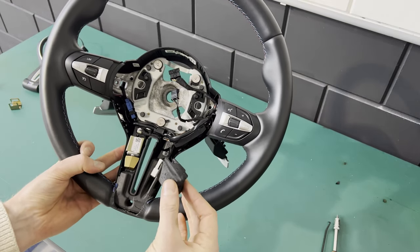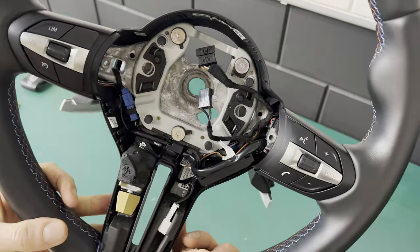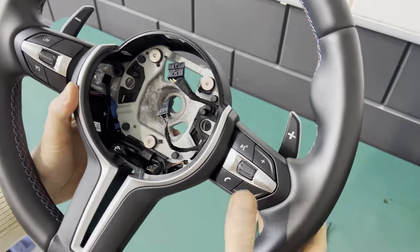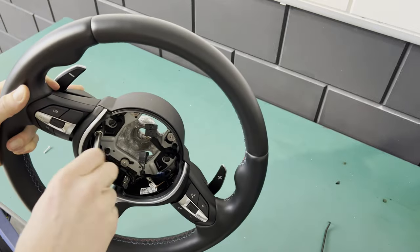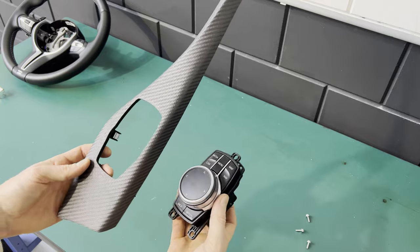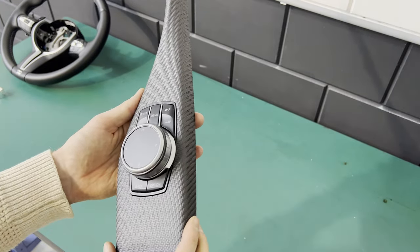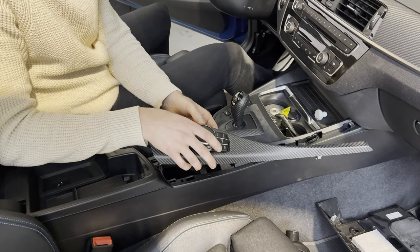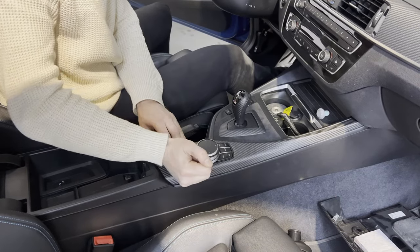Those are the steering wheel buttons installed. Then it's time for this piece of foam to cover the vibration generator — this is actually 20 euros, thank you very much BMW. Now we're going to reinstall the pedal shifters, and then this new piece of trim. That's our piece of trim installed, tightened with a screw in the back. So there we have our steering wheel assembled. Another new part is this carbon fiber interior trim. I took my iDrive controller, installed this wheel here, using self-tapping screws. Now we connect the iDrive controller again and pop the trim back in. And that's the carbon fiber trim installed.